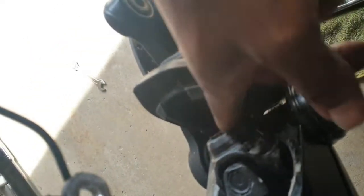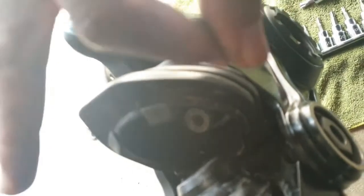So when we pull down the final drive, the rear spline will come away from the coupling on the drive shaft. And then after we've managed that, we could go ahead and use the crowbar to gently ease the front end of the drive shaft from that spline, and then remove it from the back gently.